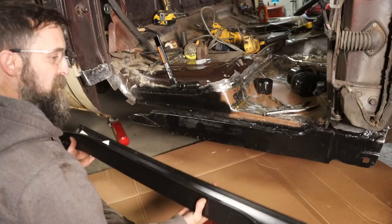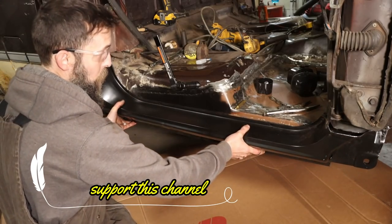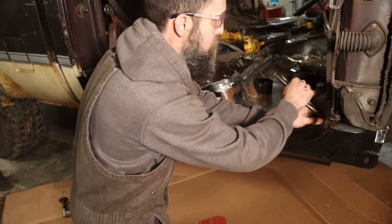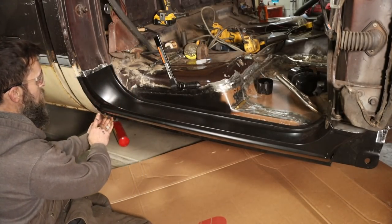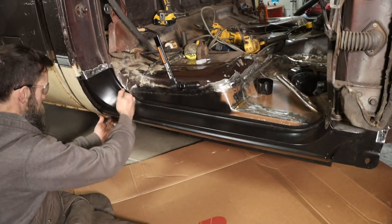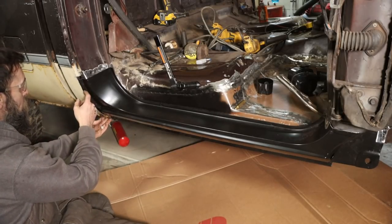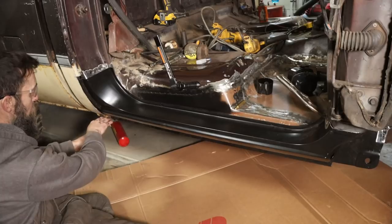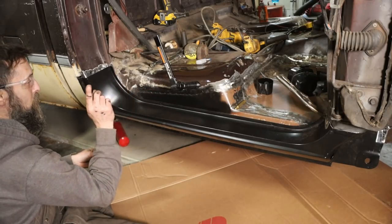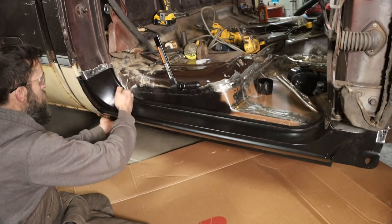Let me give you the rundown on how I fit these rockers. There may be better or faster ways — this is just the way I do it. I left the cab corner in place because you have to consider the order in which these panels were originally put on. The cab corner goes on last on these trucks, so you get your rocker on first. I like to leave the cab corner as a reference so I can get the rocker down to the proper height, because I've seen them put in kicked up a little bit and it doesn't take much — especially with worn hinges — for the door to start rubbing on the rocker.